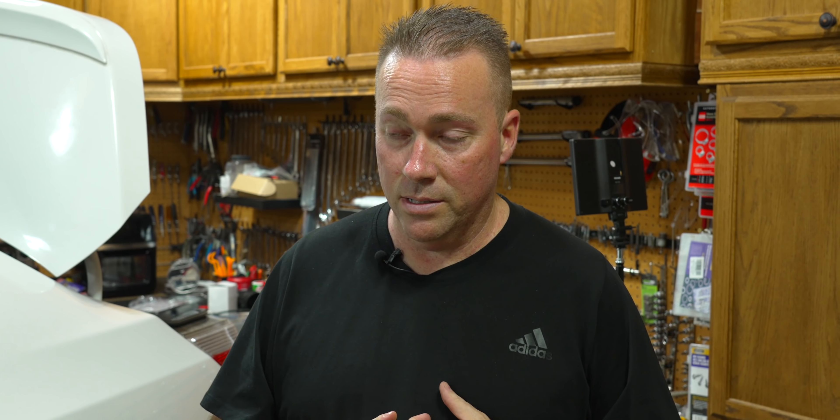Overall I think me and Philip are both really excited about doing this car. Will it need more stuff — is that why it's running rough? No, it smells like the fuel in it is so old it can barely run off of it. But I do not want to keep starting it or do anything until I do the rod bearings — period. I want to look at that Vanos pump and make sure we're not damaging anything. I did buy a brand new micrometer to measure the crank — if the crank has any scratches the engine has to come out and we either have to have the crank turned or replace the whole crankshaft.